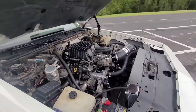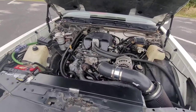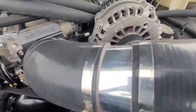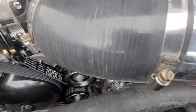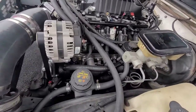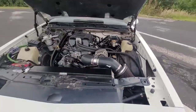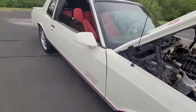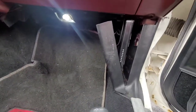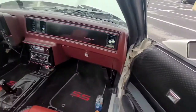It keeps blowing belts off, so I've had to replace a few belts so far. It's got ICT billet accessories up on the front, the alternator bracket down there, the dirty dingo power steering pulley. If you watch my older videos, you'll notice I had the computer right here — it's on Holley Terminator Max. It's got a 4L60 tranny in it, circle D billet converter, 2800 stall. And this is where the computer is now — I gotta find a way to cover it but it won't latch down when that's behind there. I don't think it looks terrible though.